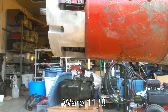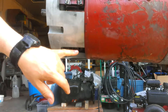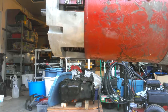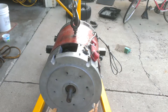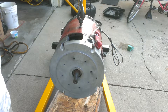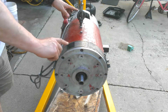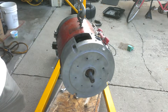On the Net Gain Warp 9 motor, you have counterclockwise, neutral, and clockwise. You've got three sets of holes that these bolts on the brush face can fit into. This one is currently lined up on counterclockwise, which is what most things in the world are. Here's our Warp 11 motor — this is the brush side with the smaller auxiliary shaft, and this side is the drive end with the bigger keyed shaft, a mesh that keeps stuff from falling in, and a shroud for the fan to blow air in.